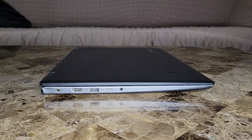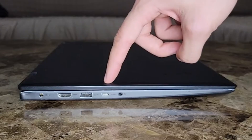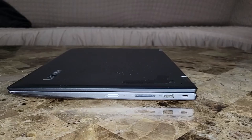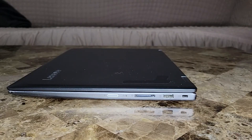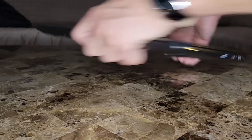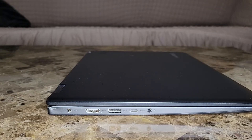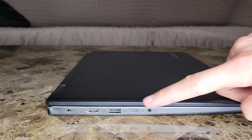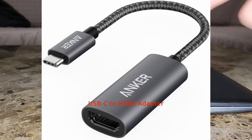Take a look at the video input ports on both your laptop and TV, then select the cable that's compatible with both. On mine, I have an HDMI port, a USB port, and USB Type-C on one side, and an SD card slot and another USB port on the other side. So essentially I only have one video port I can use directly, and that's the HDMI port. HDMI is the most common, but on newer laptops some don't even come with HDMI — only USB Type-C — so in that case you'll have to buy a USB Type-C to HDMI adapter.